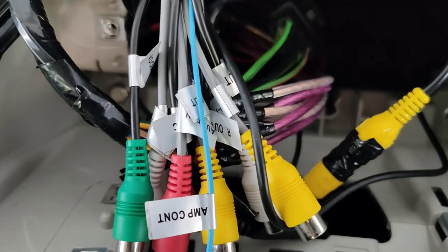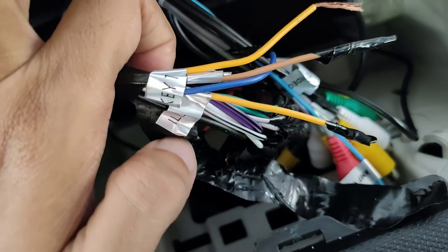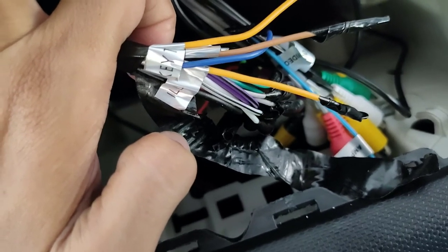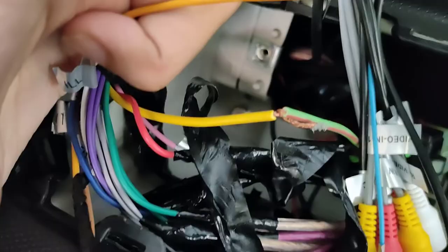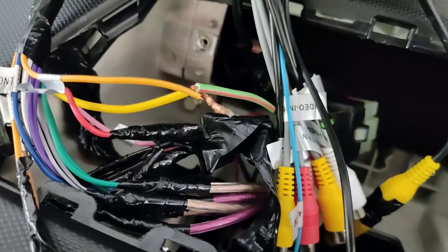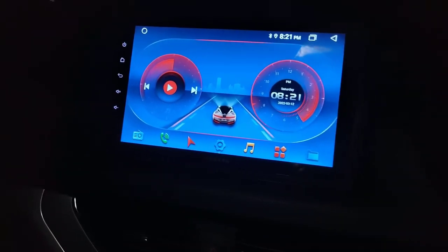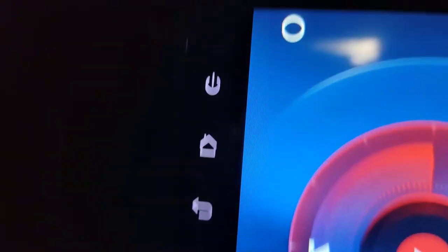First of all you will need to open the Android stereo. Here you will be able to see the illumination wire, which is in orange color, and you will also find a tag named 'illumination'. You will need to connect this wire to the positive connection, then tape it nicely and fix your Android device again. Your keypad lights will then illuminate — this is how you can easily fix your car Android head unit keypad lights.